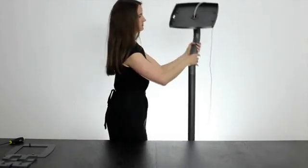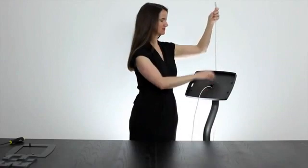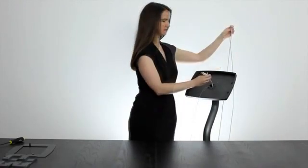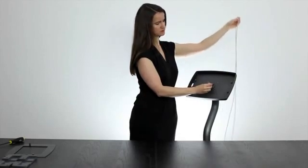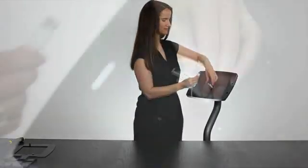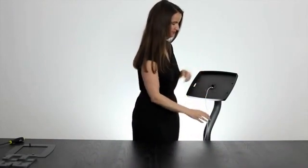Set the tube on the ground. Taking one hand on the cable exiting the base and the other on the cable entering the kiosk housing, gently feed the cable further into the unit until only a small section is exiting the kiosk housing. Take your tablet supplied cable and connect the 2 ends as shown. Loop the cable in preparation for the tablet insertion.